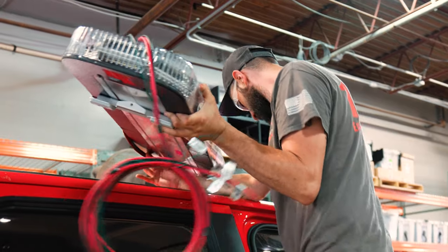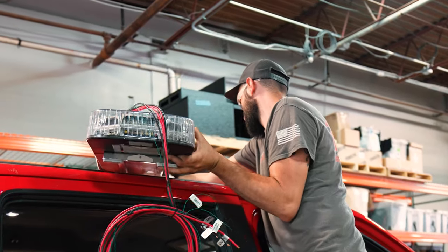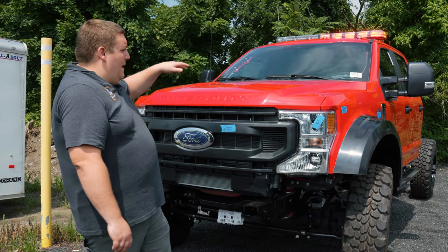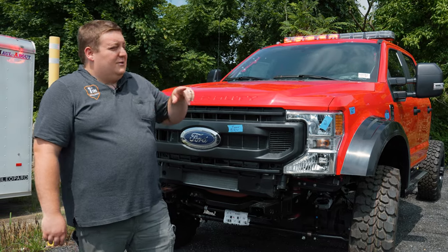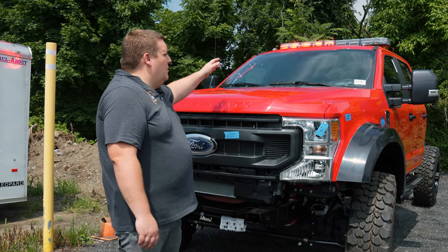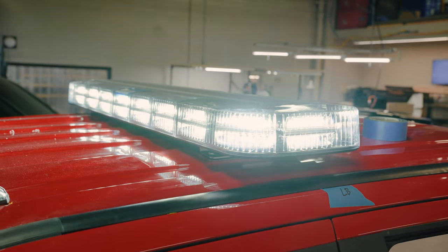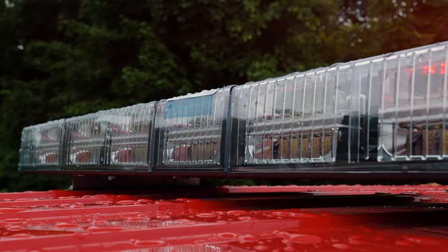It's perfect for all your fire trucks that you're looking for that dual stack style light bar. Depending on how you wire it up, you can have independent controls of the top or the bottom. This one's a dual color configuration, so if you wanted, you could program the top or bottom to come on white flood, or you could have the whole bar flashing together like a normal bar would be doing.